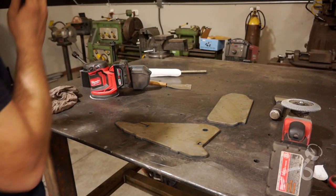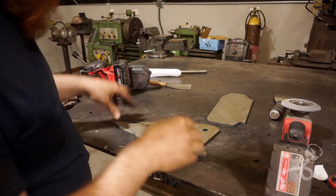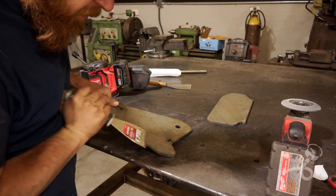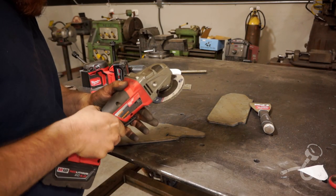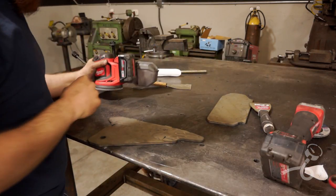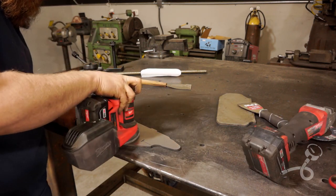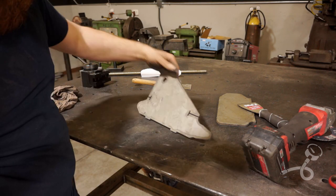Okay, so the next thing we're going to do is just knock a little dross off of this thing. And I've got these glasses for that plasma so I don't get my eyes burned. We're just going to take a scraper and scrape. If there's little extra bits, it just won't come off. And then if you want that extra classy touch, that's where this comes in. Just like that, you got some world-class, high-quality plasma cut brackets.